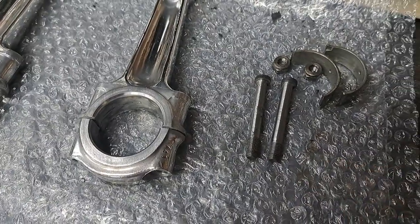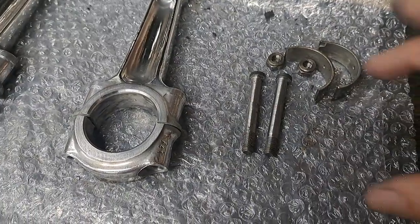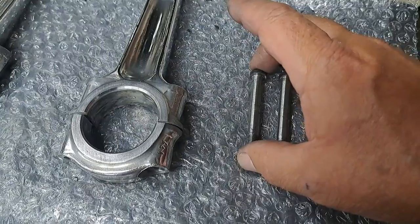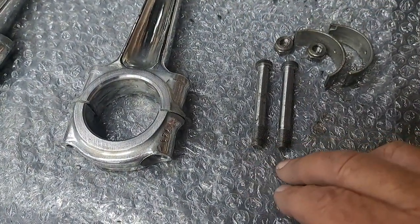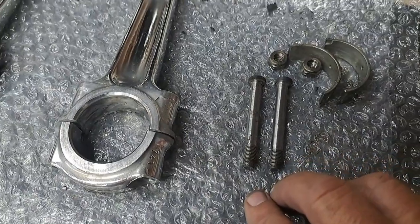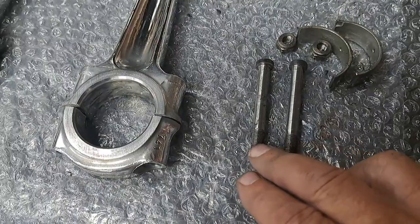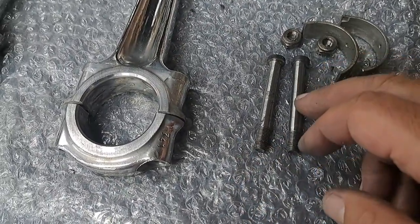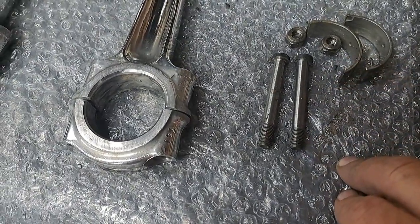But anyway, that's just my rule of thumb. I've never seen it written anywhere, but like I say, 305 is my stopping point where I would go looking for new bolts. But I would definitely go looking for new old stock, or even bolts from another set of connecting rods that had the thicker area here. That way you know those bolts were not overstressed or over torqued.